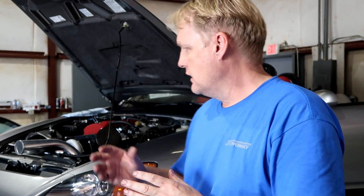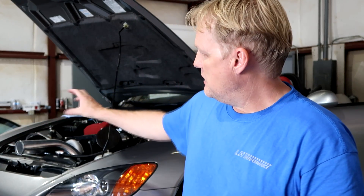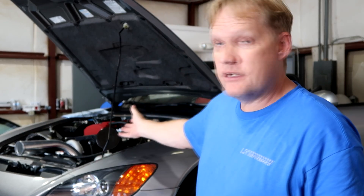So again, it's just an experiment — more of a curiosity. We were interested in how much power that supercharger actually takes. To do a truly scientific test, maybe this tube would need to be connected to something that causes a restriction, since the engine is pushing in more air than it can ingest — hence boost. How much extra power that takes, I don't know, but it's pretty interesting. This supercharger is the C38-92, which is the bigger unit — that might take a little more power to turn than the 81 blower.